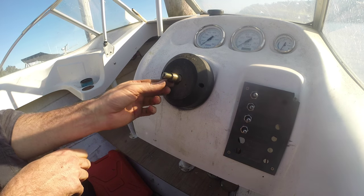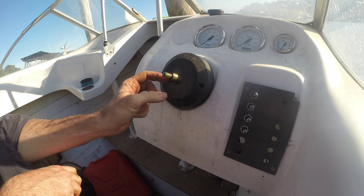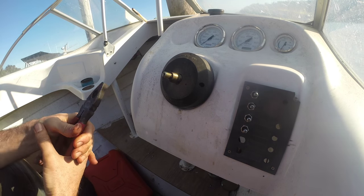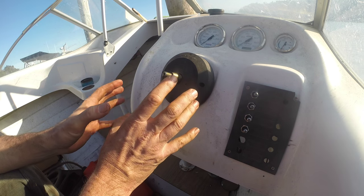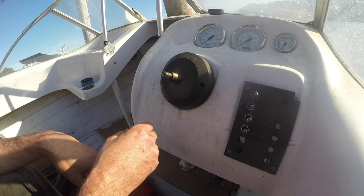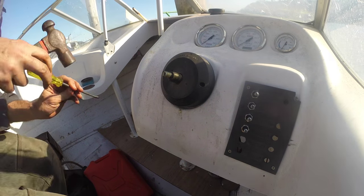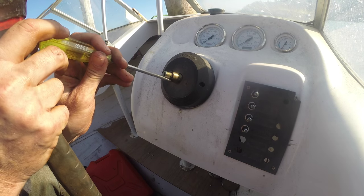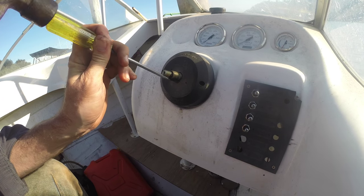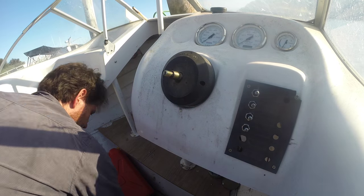Now the woodruff key — there's water in there, it's a bit stuck. I'm just gonna grab some pliers and pop that in my little parts tray. There's nothing complicated about boating or boat mechanics, particularly jobs like this, other than corrosion. Not complicated — corrosion always makes an easy job hard. Success.